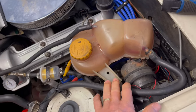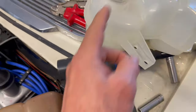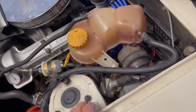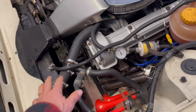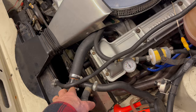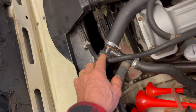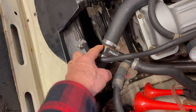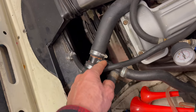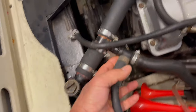This design comes with three pipes: one at the bottom for allowing the main fill water to go into the engine and probably for circulation. What's important is to get air out of the engine, so you want to tap into the highest point on the engine. I use a plumbing T-junction — probably something like a 28mm to 28mm T-junction with maybe a 22mm reduction on one end.